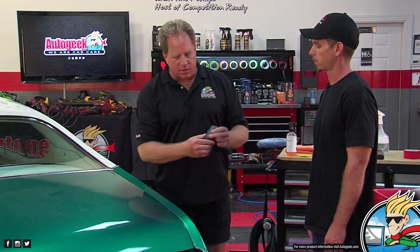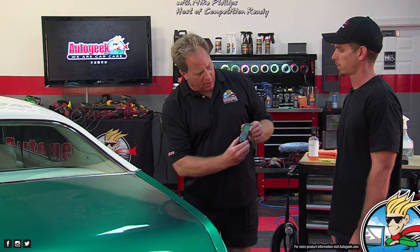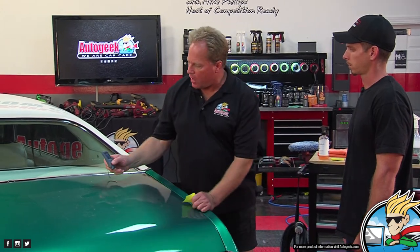And to turn it on, you basically just use it. And then if you want to calibrate it, there's two buttons here on the side. You just press them at the same time, three times fast, and it'll send it through its little self-calibration. And it takes in ambient temperature as part of the things it's calibrating. Okay, and also like sheet metal, if you get it hot or cold, it can shrink and it can throw paint thickness gauges off. So right now this is very accurate.